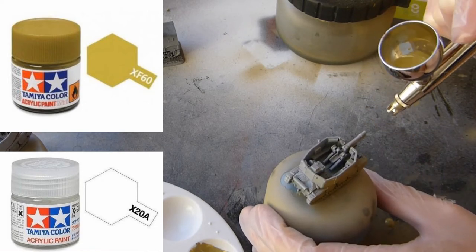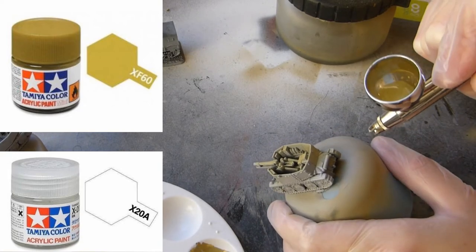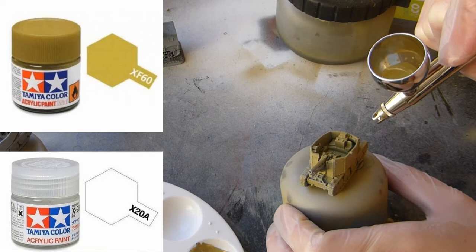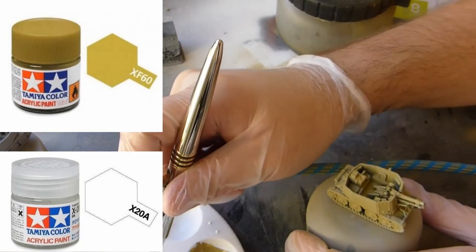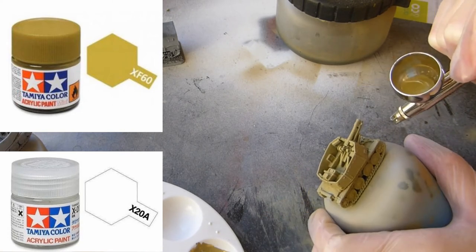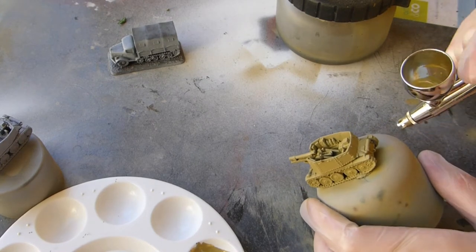You're going about a 2-to-1 ratio here — you can even put less thinners in as well. Because the needle nozzle I'm using here is the 0.40mm, I don't go for the 0.20mm. I use the 0.40mm purely for the surface area — I'm getting more spray coverage with it, so it's covering a bit more area.